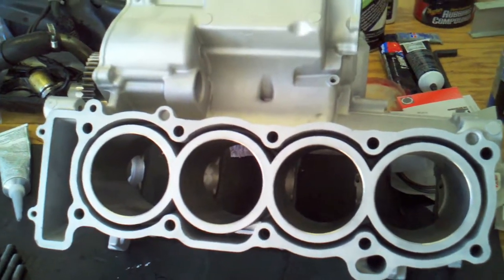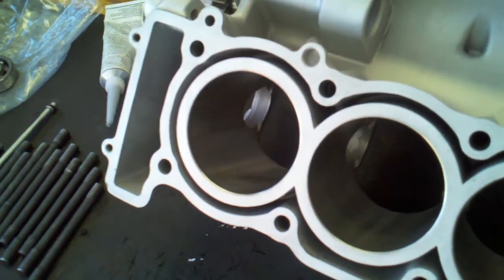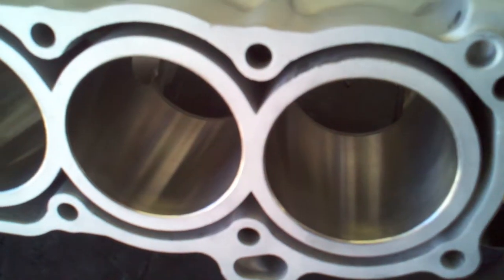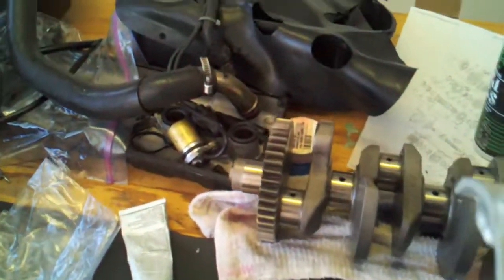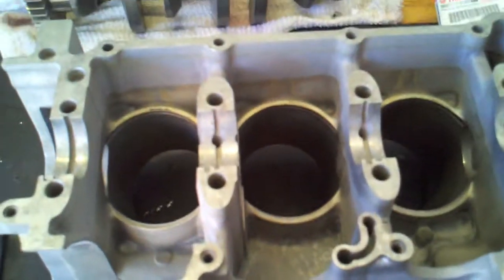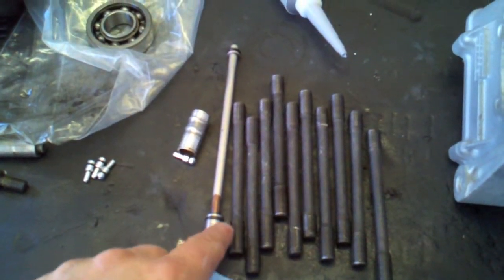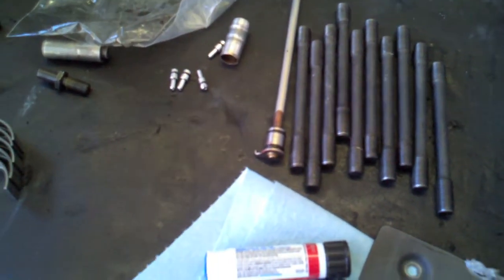I just got my upper crankcase assembly back from the replating service. The main thing is they've recoated these bores with nickel silicon carbide and rehoned them, so now I know they're perfectly cylindrical with no more interior damage or thrust marks. They also bead blasted the entire outer surface. As part of the replating process they removed any remaining components, so they pulled out the remaining pieces I left in — cylinder head assembly bolts, oil pipe, crankcase breather pressed-fit receptors, and the little oil ports that go under the journals — bagged it all up and shipped it back to me.